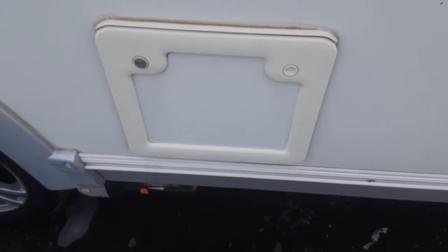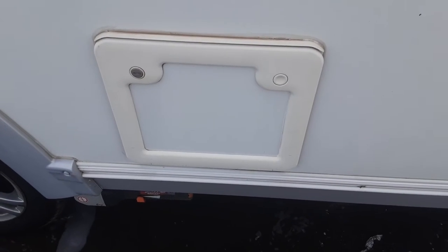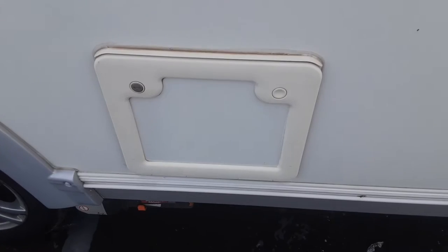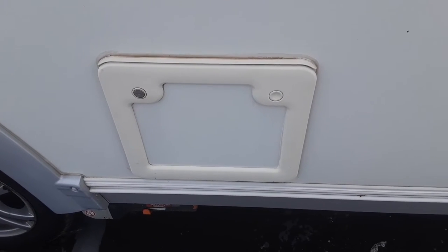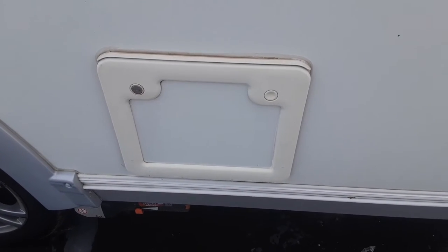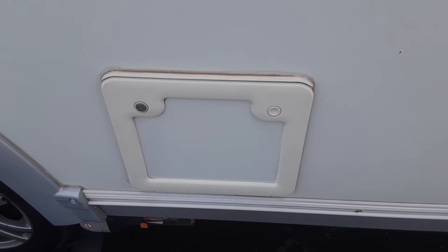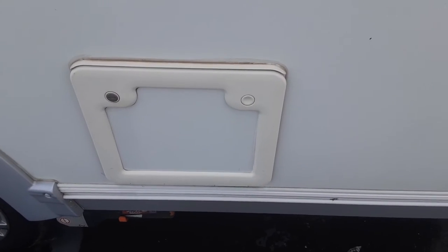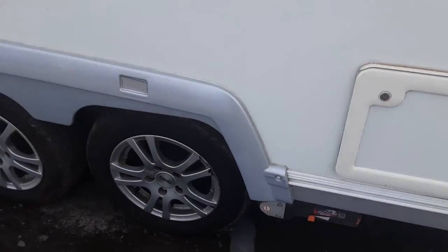You've got your toilet locker on the side of the van with the toilet waste cassette. Before use, put one litre of water and a capful of blue fluid in there. You pull the cassette out with the orange handle at the bottom. On top there's a turn-out neck to tip the waste away, and on the back of the cassette there's an orange pressure relief button so when you're tipping the waste it doesn't spit back at you.